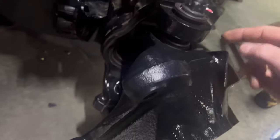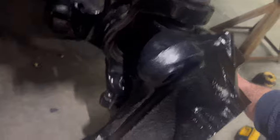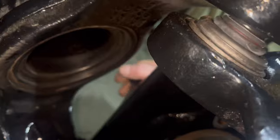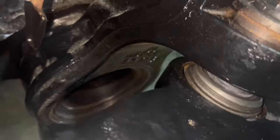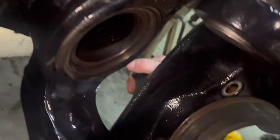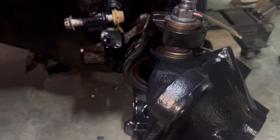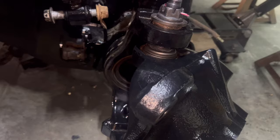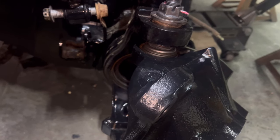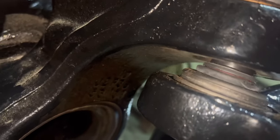I could give it a tap or two just to let it reset. We've got a little bit of squeaking going on on that ball joint. I don't like the squeak because you'll hear it when you turn. But it could loosen up — it's a sealed component. I guess I could have thrown some grease in there but it really would not have stayed there very much.